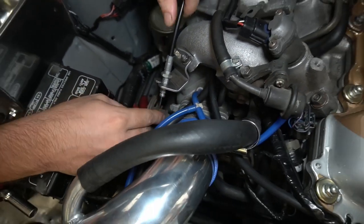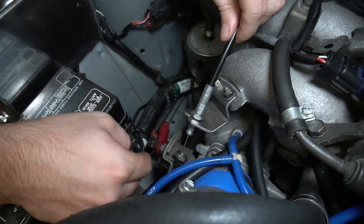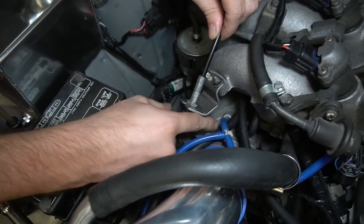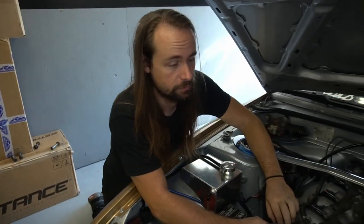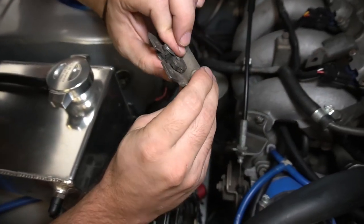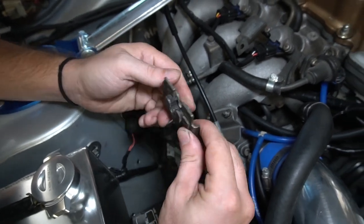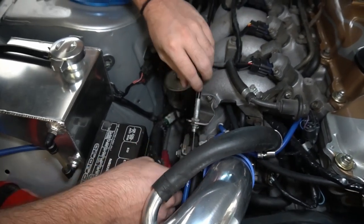Installing this is a little bit tricky, but basically just get this down so there's no slack — somewhere around there — so that when you hit the throttle it'll open the throttle body right away. Screw the bottom nut on. Also, you should put blue Loctite on these because we're getting rid of the rubber isolator — we're not using that anymore. So definitely try to keep these locked down; just a dab of blue Loctite on both nuts.